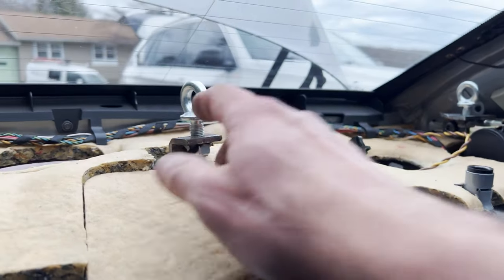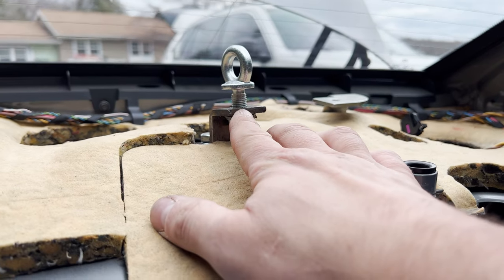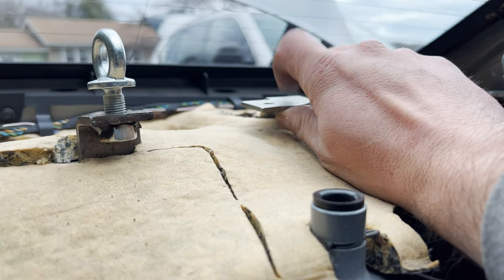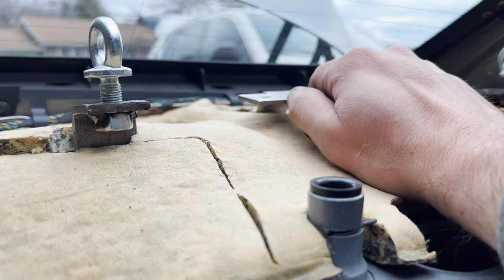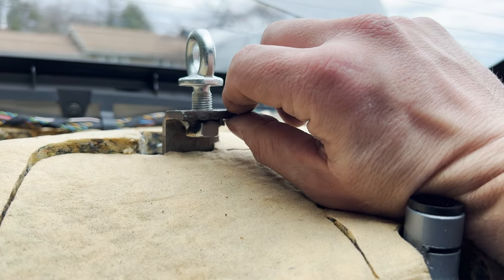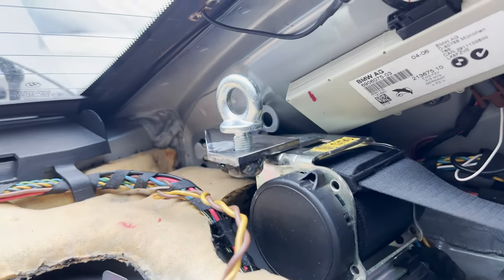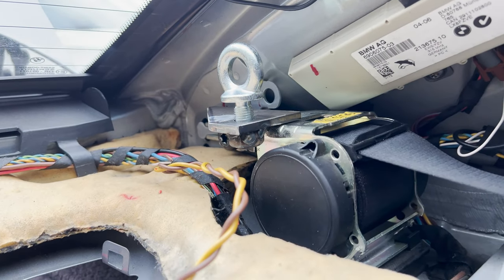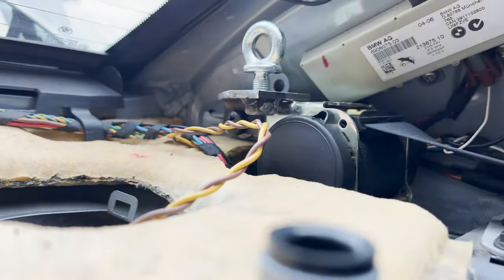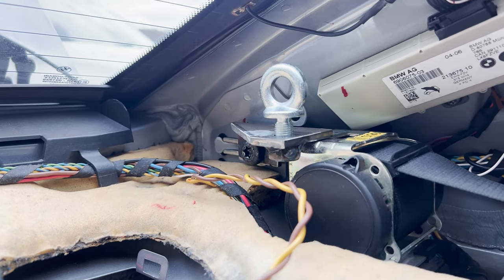And as you could see, I used 3/16 thick steel, which is much thicker than, for example, the factory child restraint mounting solution, which I believe is only a 12 gauge. So the thickness is much bigger, and therefore it's stronger. And this is the bracket for the outboard mounting. It attaches directly to where the belt retractor attaches to, so it's a factory designed solution.